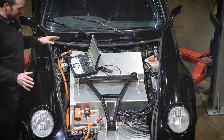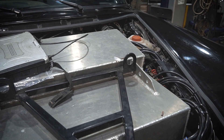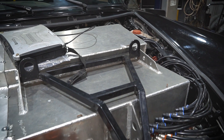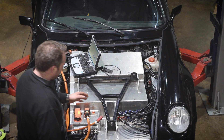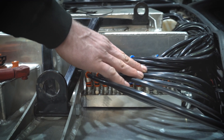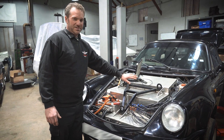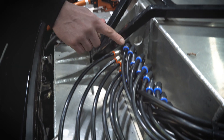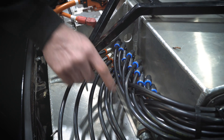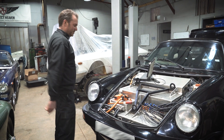We've made the battery boxes from aluminium to keep it lightweight. We've had to use thicker material than if they were steel, but it still reduces the weight and it also looks a bit smarter. We've also designed a manifold which distributes the cooling fluid to all the battery packs — there's one at the front and one at the rear. You can see there are 11 pairs of fittings: 11 inlets and 11 outlets which go to the battery pack modules.